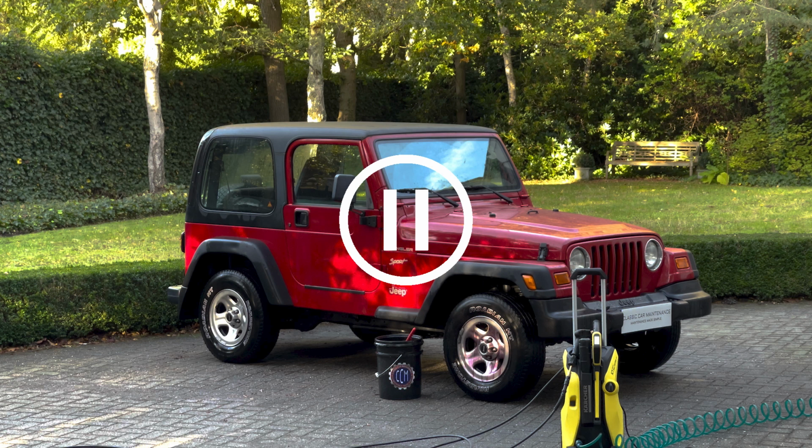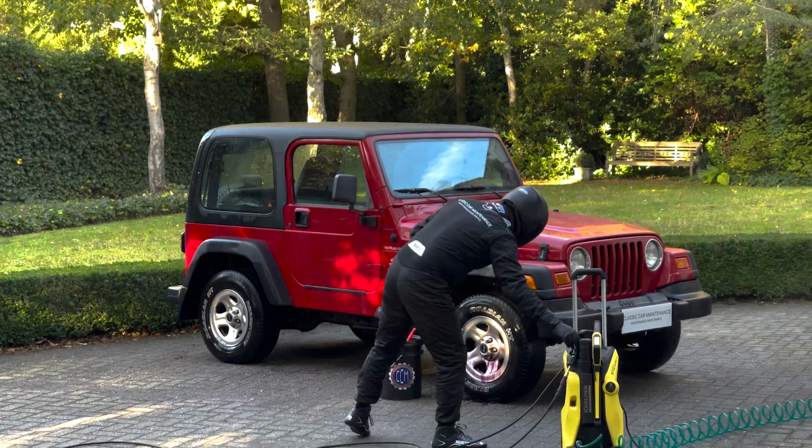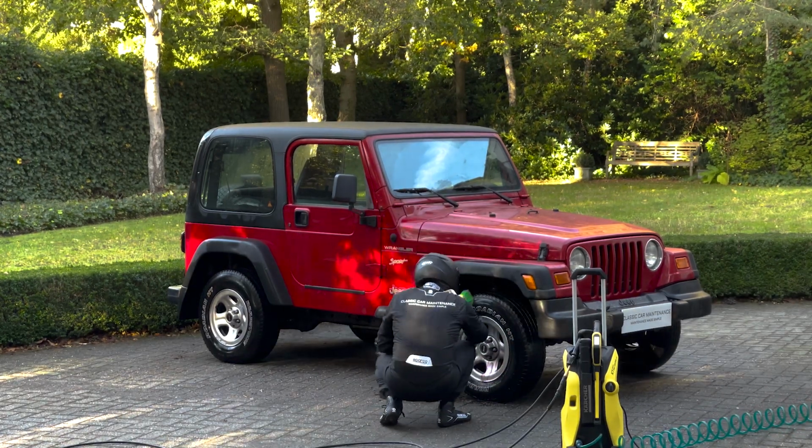It's the hot, tiny metal shavings from the braking action that embed in the paint of the wheels. The metal brake particles in disc brakes get airborne, smoking hot, instantly melting through the wheel's top coat. The enclosed drum brake design, however, makes it much harder for the dust to settle on the wheels. Any brake dust from the front disc brakes that might reach the rear wheels will have cooled down when it does. Now that the product has chemically dislodged the metal dust, it's time for the hands-on approach.